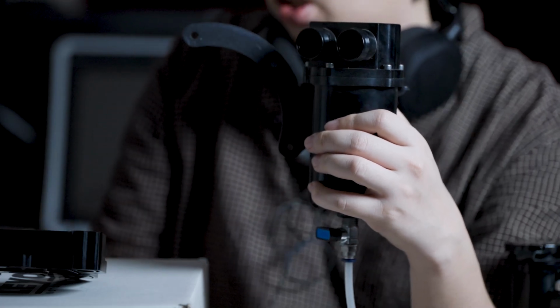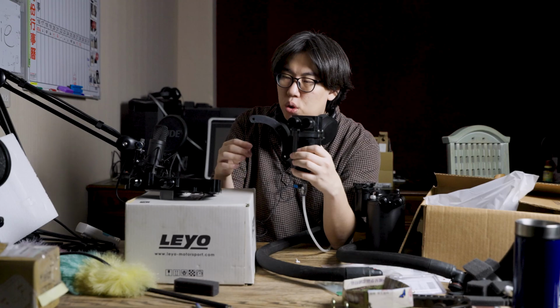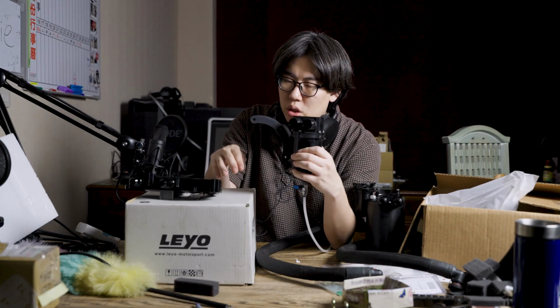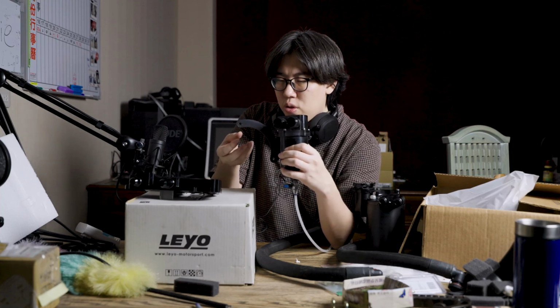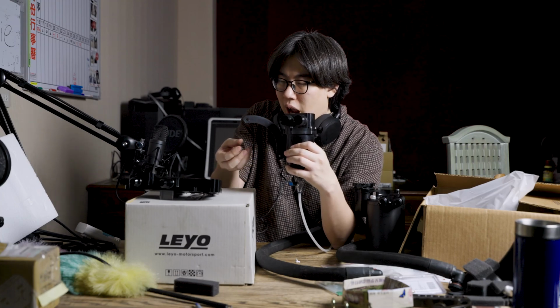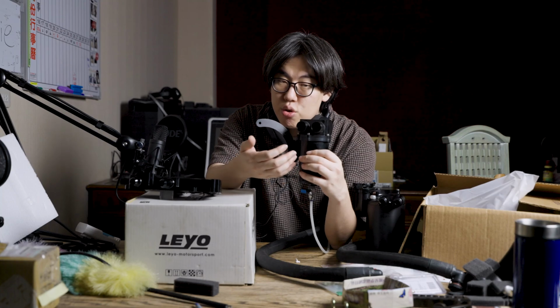In the past, car factories didn't care about air pollution or anything. Nowadays they care more about the environment, so they're supposed to recycle the polluted air into the intake manifold, where you burn it and make the air cleaner. But in the past they just didn't care. If you see a really old car, sometimes it's directly linked to the floor. Just there you go. For environmental reasons, we strongly don't recommend that. So that's why you have an oil catch can that catches your oil, obviously.